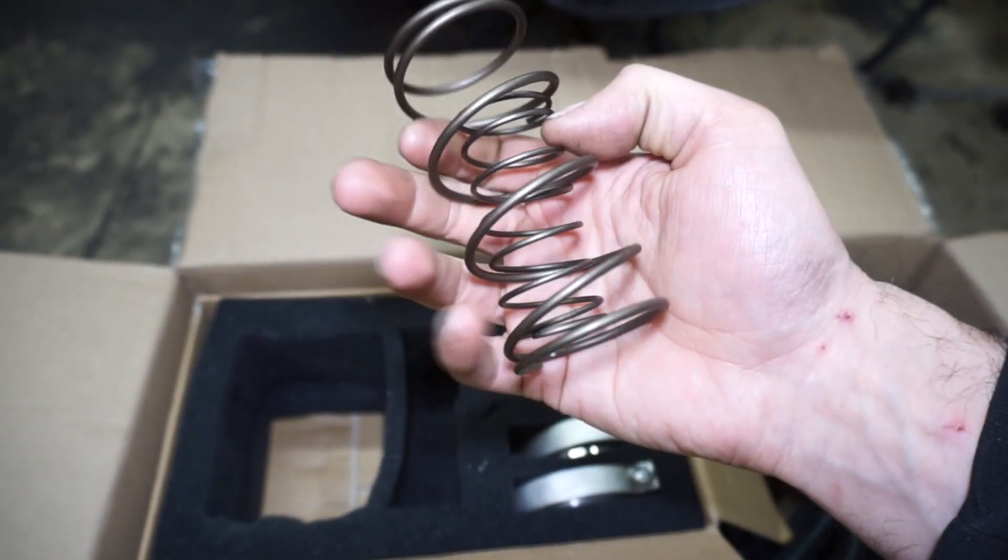It gets the wastegates out into the same position. I want to turn them both down and then use the front section of the bend in line with the balancer, and the bottom section flush with the bottom of the frame rail on each side. What that'll allow is — when the bottom is flush with the frame rail — the discharge of the wastegate will be slightly under the frame rail. The bend will come down, the wastegate will be out at a 90 or I can pivot it towards the bumper. Discharge will be below the rail and that should work out pretty good.